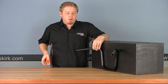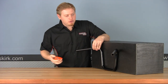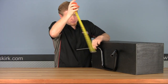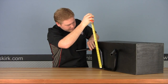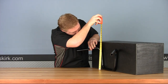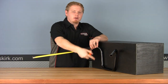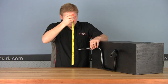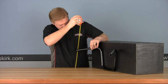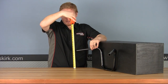That means these bars pull back an extra 7 inches for clearance. Moving on to our inside rise — from the floor up to the bend of the bars — that comes in right at 9 and 1/4 inches tall. And we want our end rise as well, because these bars come up and then bend back down. The end rise on these bars is 8 and 1/4 inches.